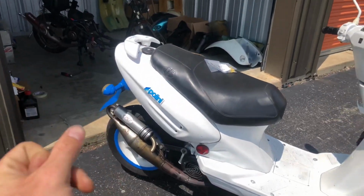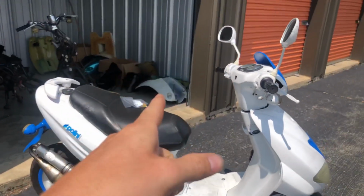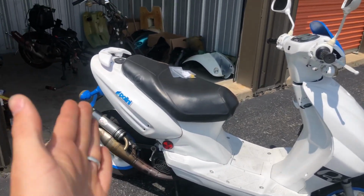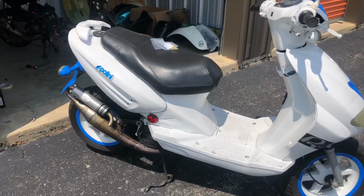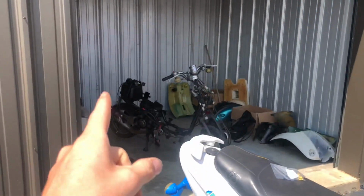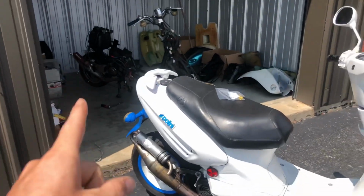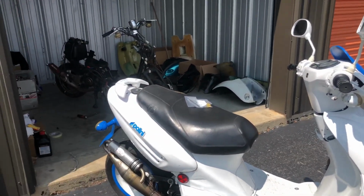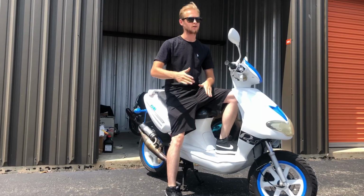I need this to get on the pipe faster. With a 2-stroke, that's what that allows it to do. When you give it gas, it raises the RPM before it even launches. And with a higher RPM at launch, you'll get on your pipe faster. So whichever one has the better results, after we figure that out, we're throwing in those clutch springs and making our way towards progress. All right, enough talking.